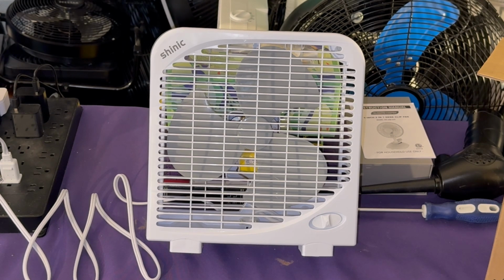But why would I put all that work into it if I'm not going to put it in service just yet? So if I plan to use this over there by the computer or something, which right now I'm using all my vintage fans, then I probably would do that. Kind of give it a couple of drops of oil on the front bearing only, and that should work. Since that's the main bearing that spins the blade, the back bearing doesn't really need that much work. It doesn't get worked that hard like the front bearing does.